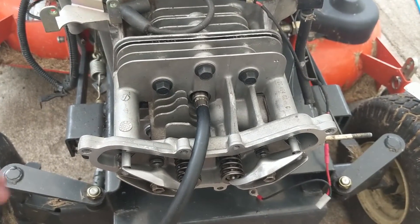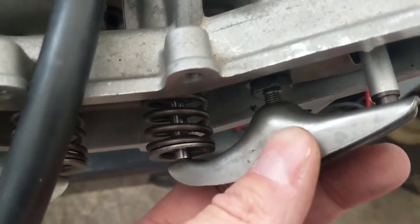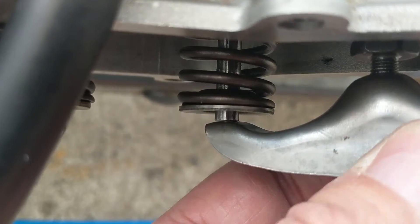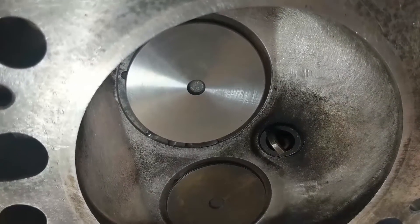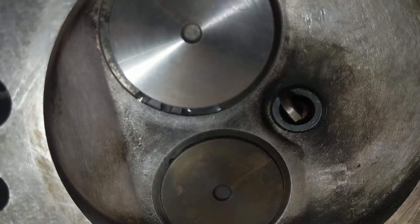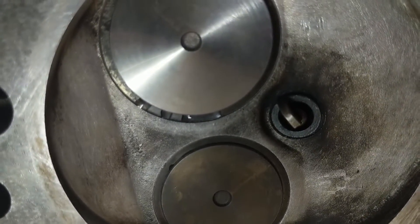This head has been off so many times. Just so you guys know it's not the rocker pushing on the valve - there's actually clearance there, you can see it. When doing a cylinder leak-down test you're simulating the engine running, building significant pressure in the cylinder on the compression stroke. In my line of business if something can go wrong it most likely will - so it's all got to come apart again. You can see there's a little water there from our previous test.